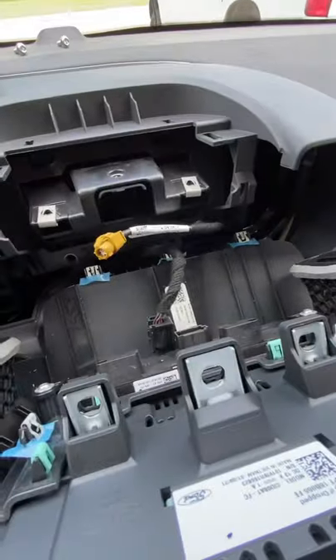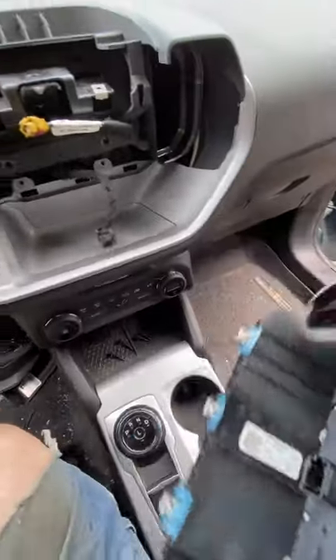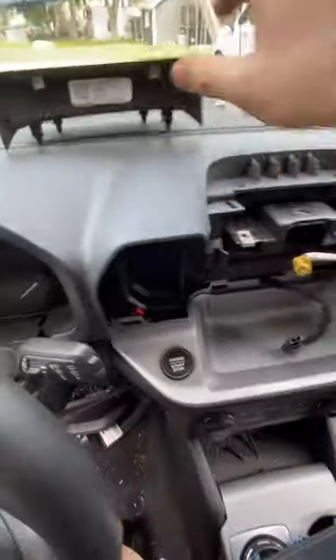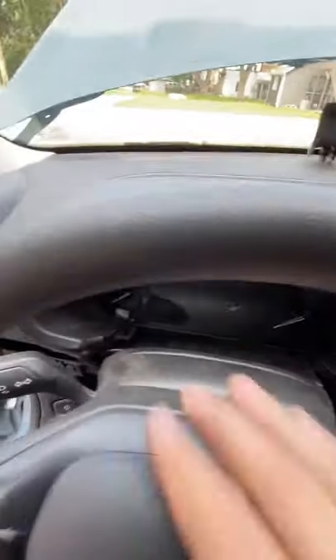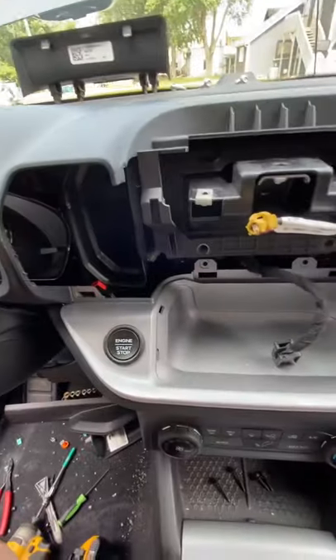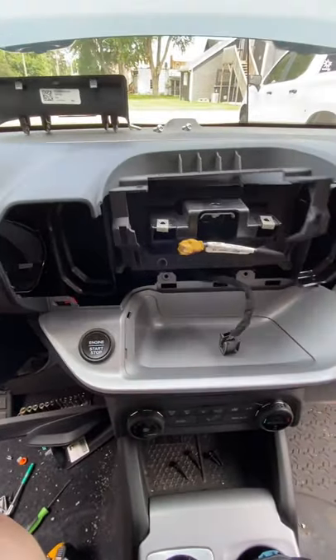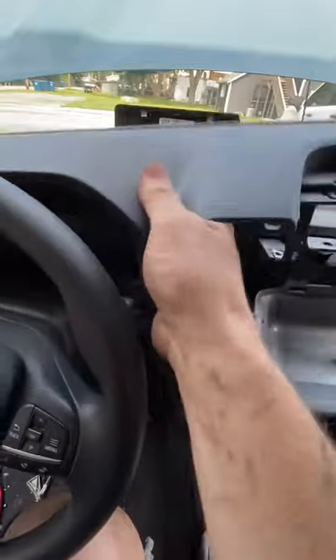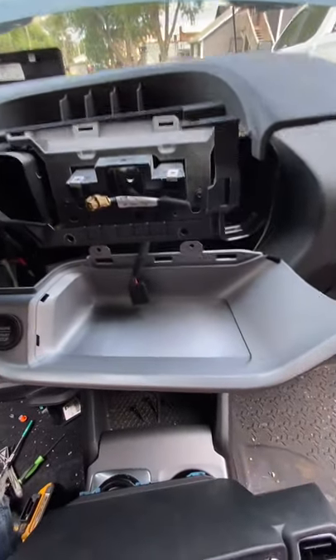There are clips, so be careful and go slow. There are two clips to unhook — the radio comes completely clear. For the dash, you have a bolt, seven millimeter, one on each side of the steering column. The rest simply unclips and the entire dash section slides out quick and easy.